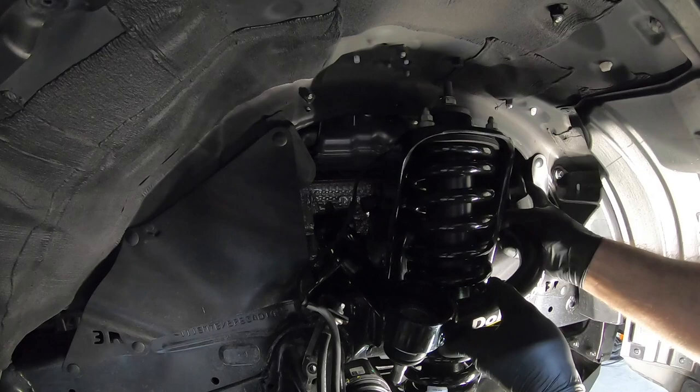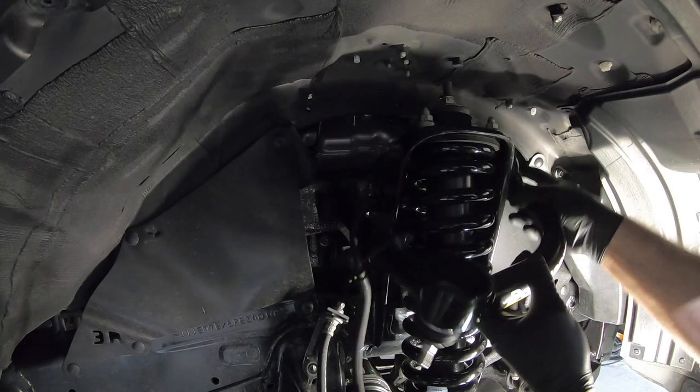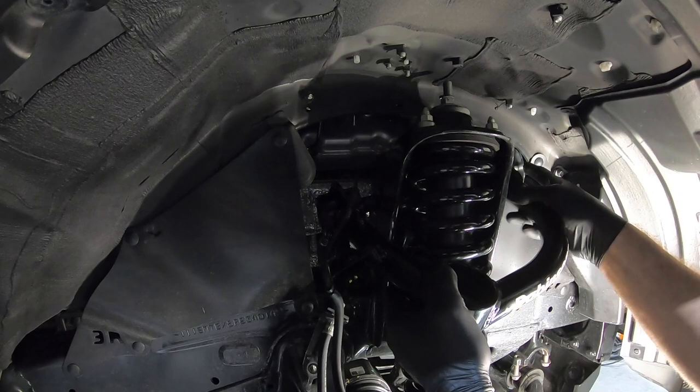But feed the bolt through the arm, start the arm on the cross shaft, and then use the washer and your fingertips to get the bolt started. They usually start pretty easy. It's that next 8 inches that takes all the effort.